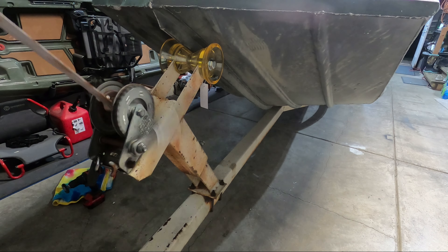As you can see, the new one is going to be much bigger and sturdier. I looked on the side and this is actually a 600-pound winch versus the new 1500-pound winch, so I'm much happier going to a beefier winch. This winch mounts in the reverse way the other one does, so the handle is going to be on the left-hand side of the trailer. Since we're using the same bolts, we're already hooked up with the same hardware. The flat side goes on the flat side — go ahead and thread on the lock nut. Hook it up under the bow roller so when the winch pulls it in, it's being pulled down onto the bow roller.